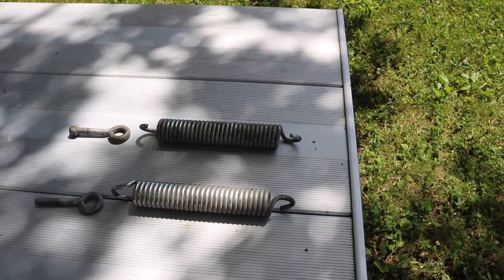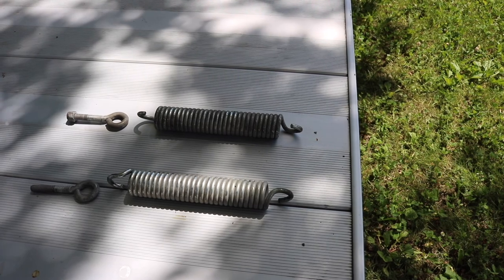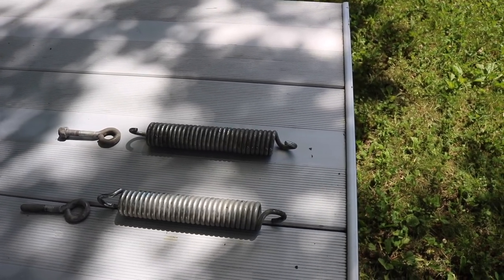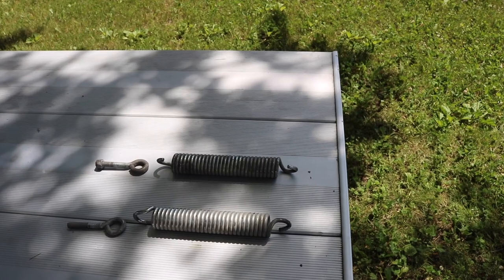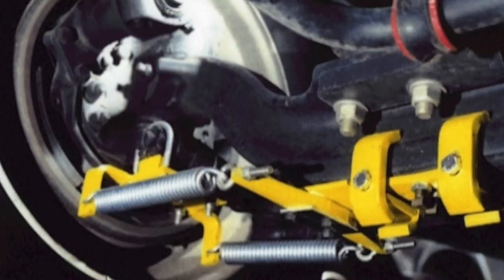The first chance I got I took the other side off — those are the springs pictured on the picnic table. Then I drove to Milwaukee and the RV feels fantastic. I have exactly the steering feel I would expect between the steering wheel and the front wheels. Here's what I think was happening: because these RVs have power steering, when you start to turn, the hydraulics kick in. With the springs on there, the hydraulic pressure wasn't enough to begin turning the wheels until you turned the steering wheel just a little bit further.